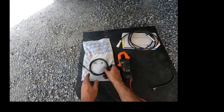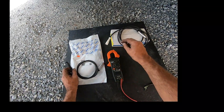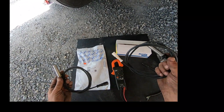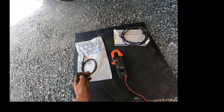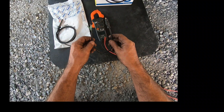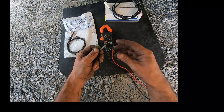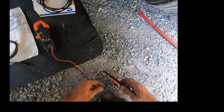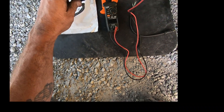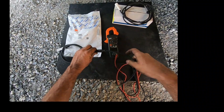Here's a brand new Wabco speed sensor and a brand new Bendix speed sensor. They're both straight and relatively the same size — the Bendix is a little longer — but they ohm out differently. When working on ABS, it's a good idea to make a test adapter off an old speed sensor extension cable: take the male end, terminate the two wires, and hook your meter leads up to it. It's very hard to get meter leads into those holes without crossing over, so this adapter makes it much easier.